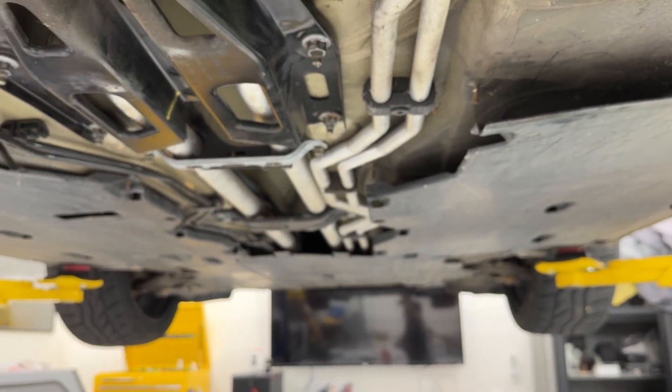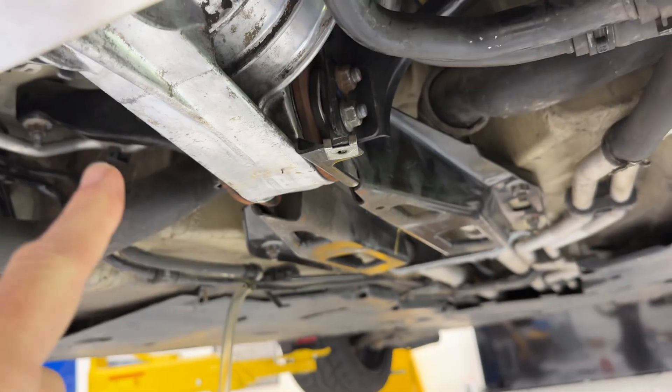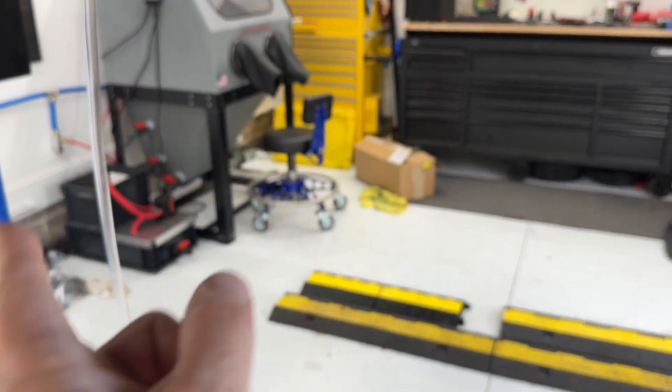Step two is I'm going to lower this car back down so I can put a new battery in it and get P-WIS set up. Now if you turn the ignition on with the battery in there, it's going to try to pressurize your fuel system and spray some fuel out of here. So I'm going to make sure I have my gas can under here to catch the old fuel. If you don't have P-WIS, I think maybe you can use Durametric — I'll try to put a link up or go search my channel for P-WIS.